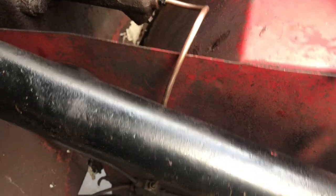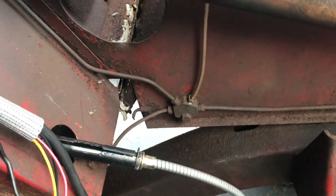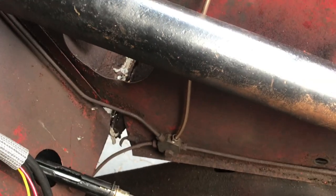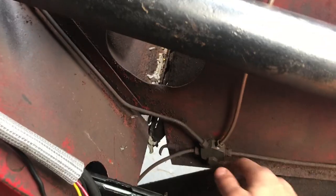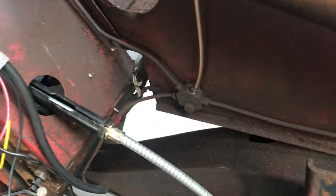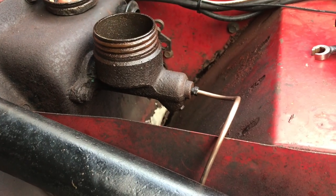We'll start mounting the new one, and then once our new proportioning valve is in, which is this piece down here, because you have to get one also for your new disc brakes up front. That's coming from Jegs and it's still on its way, so it might be a little while until we see it. But all you have to do is take this off, drain it here, but I don't want to touch that because I'm going to break it. And then you should be set to pull the master off and then install your new one. So I'll show you how to do that real quick.